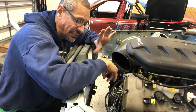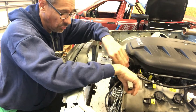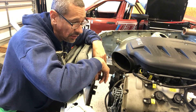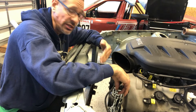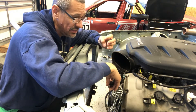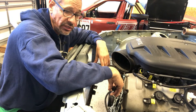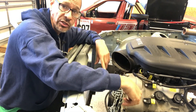There were two methods to installing the engine and getting it mounted in the chassis. One was creating the mounts and adding them to the actual chassis rail. The other was using the actual crossmember and modifying it to get it to work. As of right now, I will have to modify the crossmember because of the way the engine is sitting — it's sitting too far forward to clear the OEM crossmember. So I'll be cutting that up, tubing most of it, and then adding the power steering rack. Hopefully that gives me enough room to clear the OEM oil pan. We're also going to have to mount the sway bar on the front side of the engine instead of the back side.